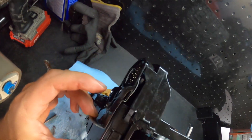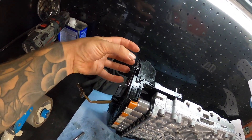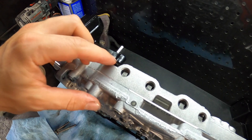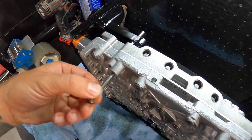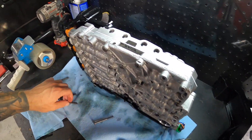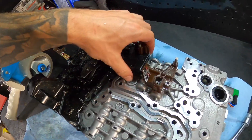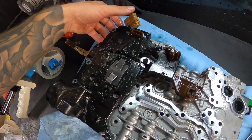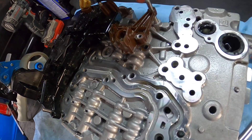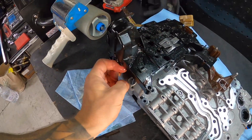You'll see this little retainer — pull this out and it's going to release the actual plug that goes into your transmission. Then pull that plastic clip out of the transmission so you can get this out. From there, just look and you'll see which ones screw into the valve body. All of these solenoids — it slips off of them. And you'll see this. So this will start to lift straight up, and you'll see these locating posts here. You're just going to lift this whole thing up.